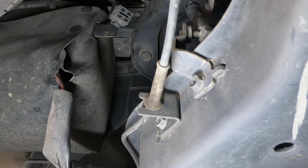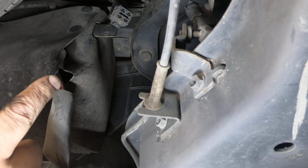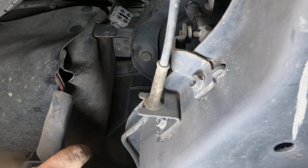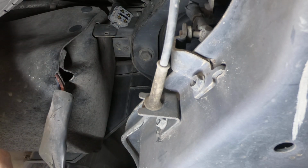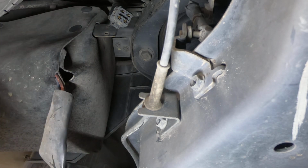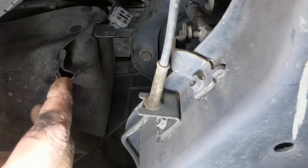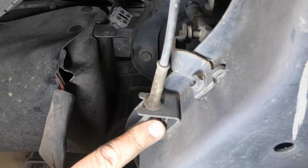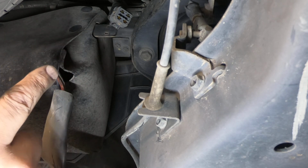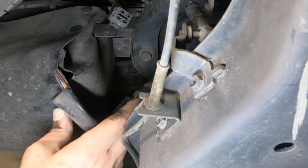Okay, so there is nothing coming in on the pump. When the relay clicks, I should get power and ground back here. Or I should get power. Ground is, I should also have ground. But I clipped off to a bolt and the actual ground for the pump.